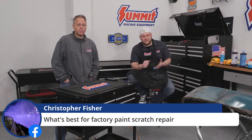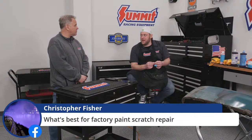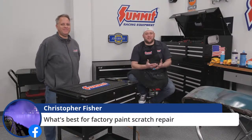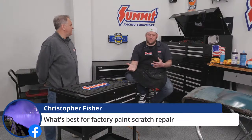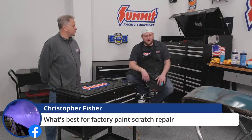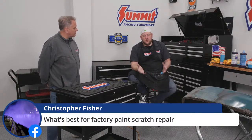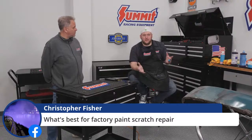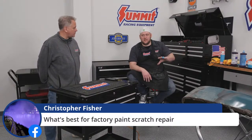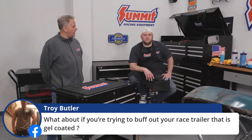But you're going to want to use that, and you want to go faster, so it heats up the paint, and it'll close the gap with the paint and make it heat up and melt, for lack of better terms, melt together. Because like we said in our other video, all this stuff is still active chemicals, so it just depends on how you work it. You would want to go with a regular compound, and then I would use like number 7 and then 26 over top of it to make sure it seals in and really blends nice and gets rid of those compound scratches.